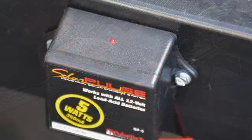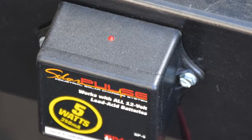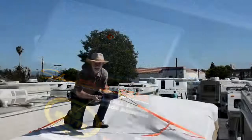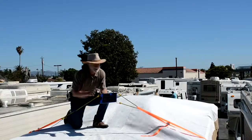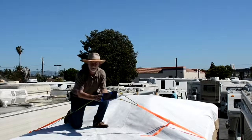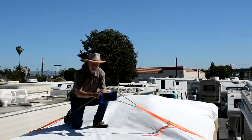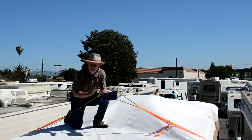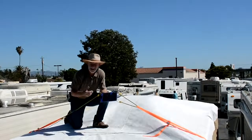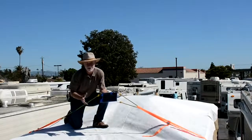The LED on the circuit box glows red to indicate an optimal charge is taking place, flashes when in partial sunlight, and goes off at night. Solar Pulse has high efficiency, high quality crystalline silicon cells that pack more power into a smaller package. I'll have to take their word for it on the engineering, but I do know this little panel brought my in-series six volt batteries to a full 12.7 volt charge in just a few days. With the Solar Pulse installed, it's really just a joy to leave the batteries on the rig and look forward to heading out on our next trip with a full charge.